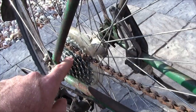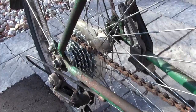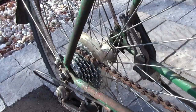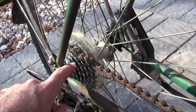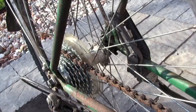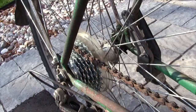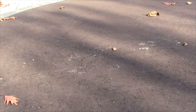Unfortunately, if you replace a cassette and you're still using your old chain, you're going to find that the chain is skipping a little bit on the sprockets. The reason that happens is because the chain and the sprockets wear at about the same rate — particularly noticeable on the small sprocket since it has the fewest number of teeth. Over time they kind of change shape, but they remain compatible because they're changing at the same rate. But if you suddenly replace one of the two, you'll notice a lot of problems with the chain skipping. So since I've replaced the cassette, I need to replace the chain now.